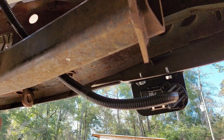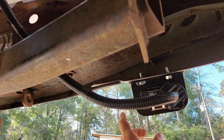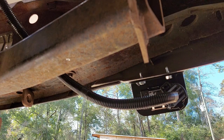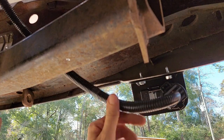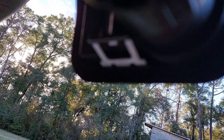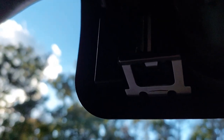And there you have it. At this point you've got factory OEM-equivalent operation restored to your truck — except it doesn't cost $185 like Ford wants. You got it for roughly $100, and I consider this a good repair. I noticed when I installed this that it wiggled a little bit — the locking brackets are supposed to pop down at the bottom and then pop up at the top, and they didn't go all the way. So if you take a screwdriver, pull one down and push the other up, they'll fully extend and snug up the connector so it won't feel wiggly in the bracket.